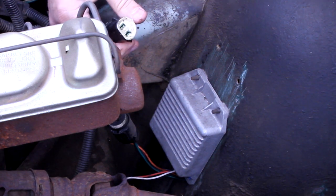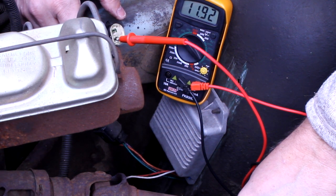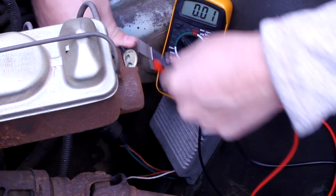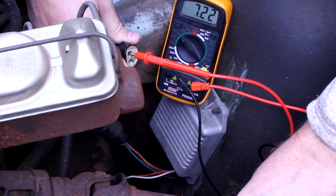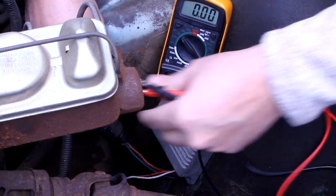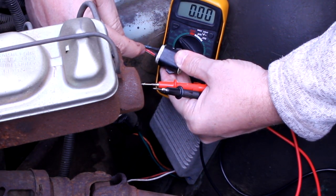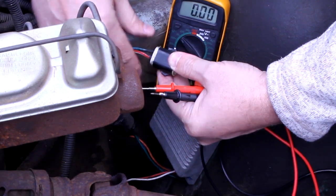At this connector, that red and white wire gives me almost 12 volts in run mode — so that's going to be my run wire, and it's going to connect to the pink wire in my harness. Swapping to the other wire and putting it to start — 12 volts on start for that one too. So bypassing all that stuff over at the starter solenoid, these are the two wires I'm looking for. The red and white will be my run wire connecting to the pink wire on my harness, and the baby blue goes to what's listed as purple on my diagram.